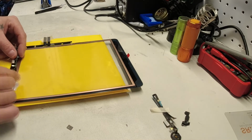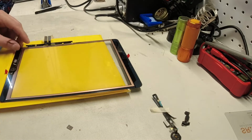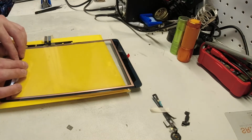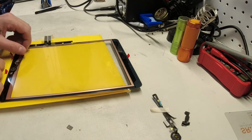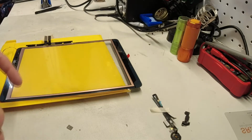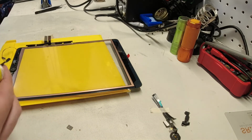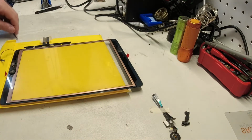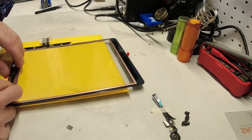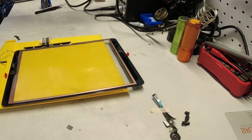Alright, and once you've gotten that out, place that down. You want to make sure that this gold, the little flap with the gold on the back of it, you do not want to touch down yet, because that's going to sit on the back of this post that holds down the... actually, that's not right, disregard. So they just use this strip adhesive, which I don't find to be very effective, so I do not strip adhere mine down. I actually will use super glue